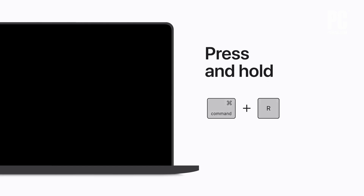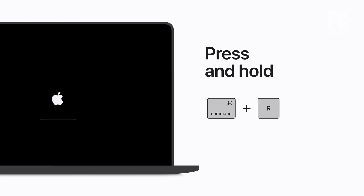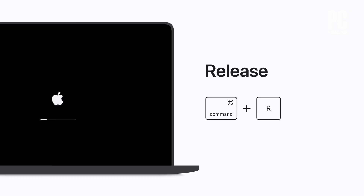First, you'll need to restart your computer. Once you do, immediately hit Command and the R key as it's restarting until the Apple logo appears. After that, you'll then release those two keys and allow your Mac to boot up. Instead of opening up your desktop as normal, you'll then see that your Mac will boot into recovery mode.